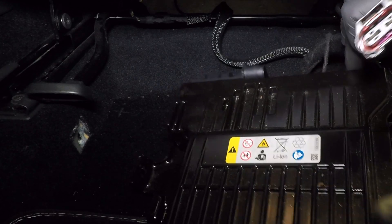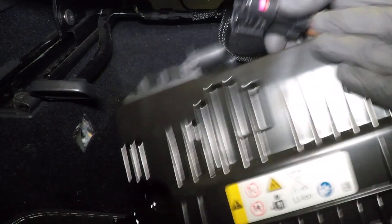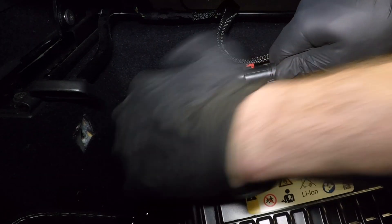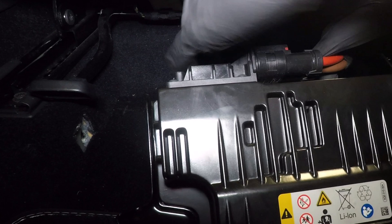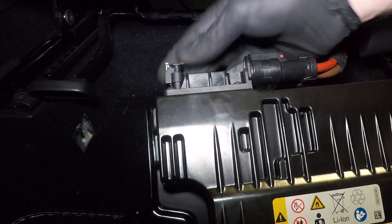I'm talking from experience here, so please learn from my mistake and don't do this as well. You can just replace the coasting battery and the fault will erase, and the vehicle will operate fine, but after a few weeks or months the battery will fail again if you do not replace the Q diode. Trust me, I've learned this the hard way.